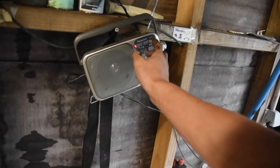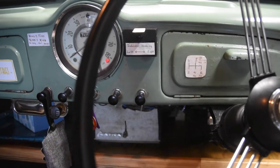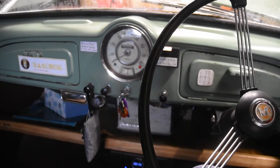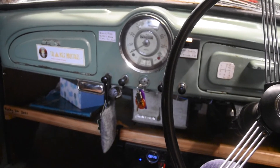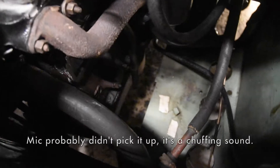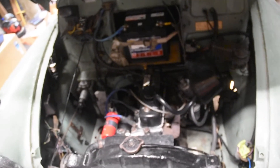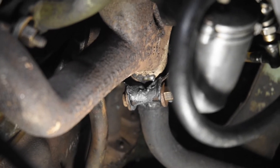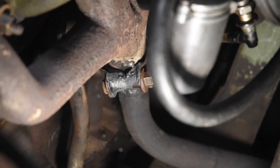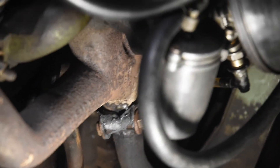I took it out for a spin — that's why the car's wet. I'll start it up for you now. Firstly let me shut off the radio. You can hear it's a lot quieter when you rev it. But you might be able to hear a chuffing sound. That chuffing sound is the exhaust flare leaking a bit. I tried putting some JB Weld and used a vacuum from the tail pipe to suck it in — that did work but it's not fully set so it blew out again. That stuff isn't rated for exhaust temperatures anyway, so I think I'll buy the proper stuff and fix it properly.